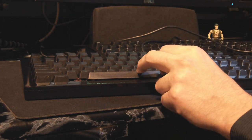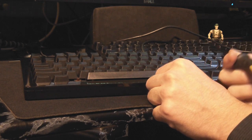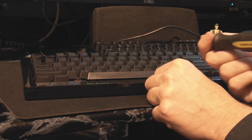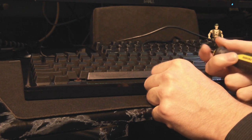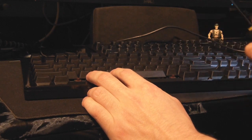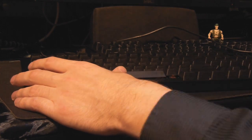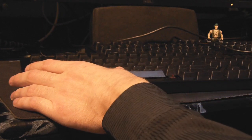What I'm going to be doing is pushing on the key one way and prying on the metal bar the other way, just to get enough clearance to remove the metal bar out of the stabilizer and remove the key. I'm going to be twisting the screwdriver a little bit to make sure I'm prying at an angle as much as possible and not just pulling on the bar. I'll have to navigate around here and try to do this and still keep it on camera.